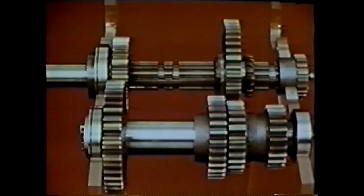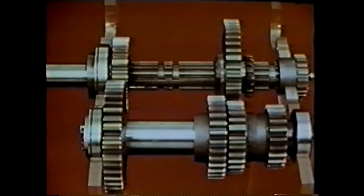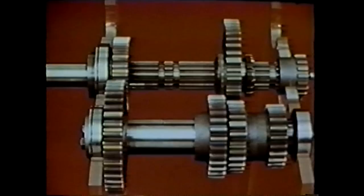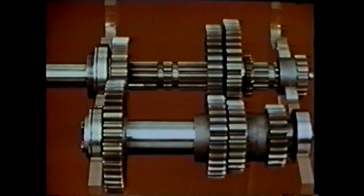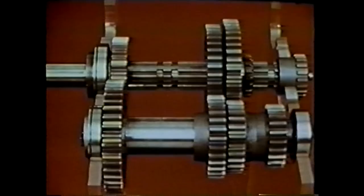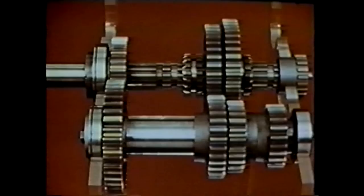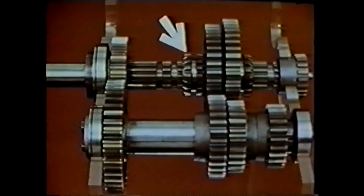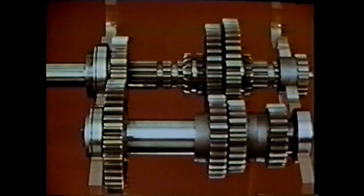For added speed we must change gear ratios. We add second gear to the counter shaft, coated in blue, permanently locked to the counter shaft. Then the main shaft second gear, also coated blue, is added. Since this is a constant mesh transmission, main shaft second rotates with counter shaft second at all times, but it has not yet been locked to the main shaft. To lock it, we add a sliding clutch to the left of main shaft second. To shift to second, we disengage the first gear sliding clutch and engage the second gear sliding clutch — only one can be engaged at a time, otherwise we'd be driving the main shaft at two different speeds at once.